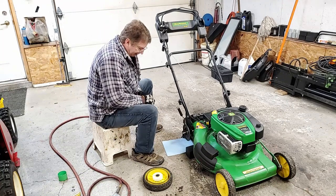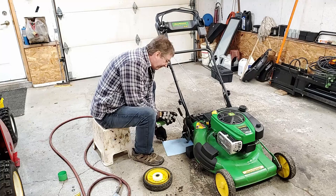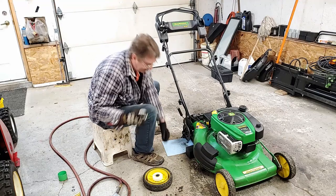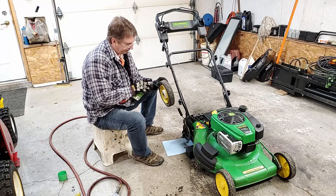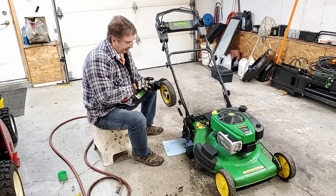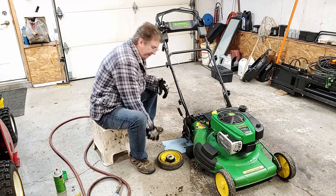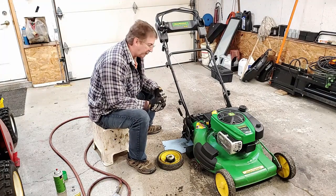Which I suppose you can get away with not even greasing them, but to be on the safe side, let make them last longer, I prefer using a bit of graphite. Graphite is black. Yeah, if you leave that sit for a bit, it's just going to dry up. And it's like, say, it's a dry lubricant. You don't have to worry about dirt or anything sticking to it.